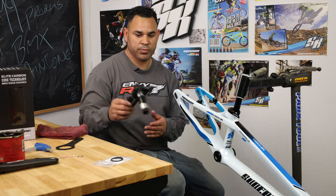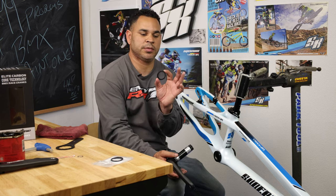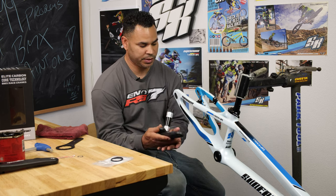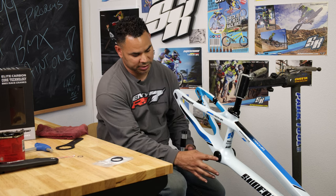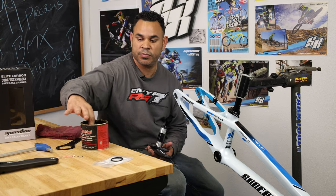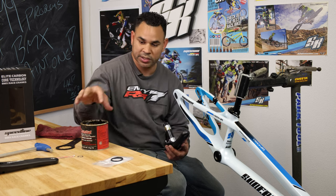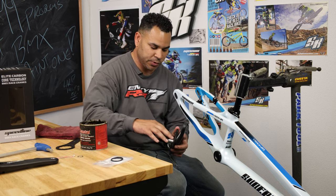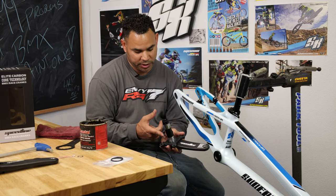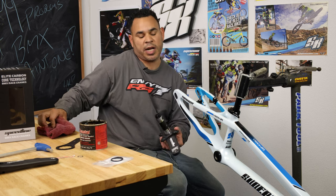Go ahead and take a little bit of that grease out of the way. Now with your drive side crank on, included in the cranks is going to be this little polyethylene washer — you're going to slide that right over that 30 millimeter spindle. What that's going to do is basically keep this bearing interface nice and smooth. And again, anything that's a moving part, you're going to want to hit with a little bit of grease. So let's go ahead and throw a little bit of grease on the spindle — this is essentially going to keep those bearings lubed and keep everything running really nice. You can put plenty on there, you can always wipe up the excess. Keep a shop rag around.